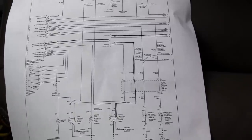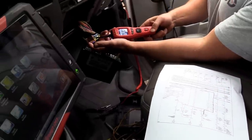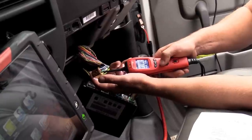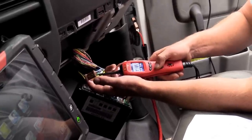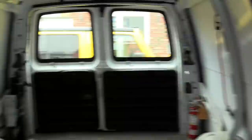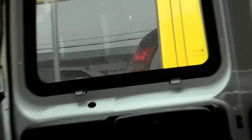That's not a perfect test, but that's what that test is used for. So knowing this is my turn signal circuit, I'm going to simply flip the switch - it's disconnected from the BCM. This is my turn signal circuit and that should light. Right now the right side should be lit. I can see it in the reflection of that Jeep. There's the - that's me flipping the switch, making that light turn on and off. So how is my bulb? How's my circuit? How's my integrity? It's good. And my brother had already confirmed that.